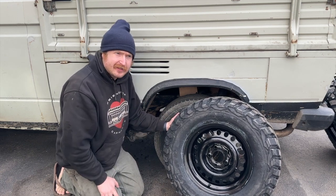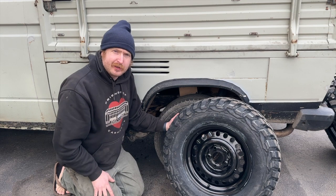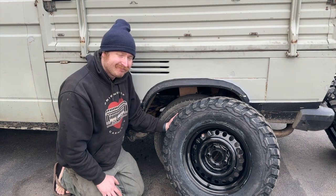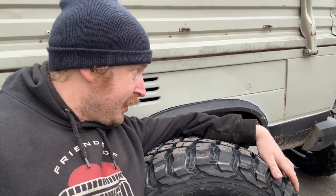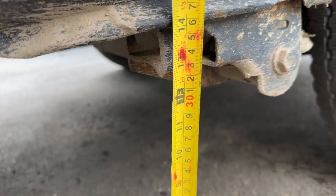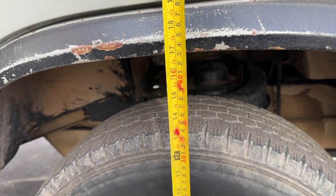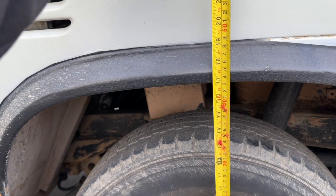We've got these big, massively heavy tires mounted to Go Westy steel rims — Go Westy manufactures these to be the correct offset for a Vanagon. I like steel rims because they tend to be the most durable and we're going to beat the crap out of this thing. I took some measurements — these tires are about three and a half inches bigger than the stock ones, which is significant. We're taking measurements around the chassis so we can see how much the overall vehicle goes up once we add the lift springs and the giant tires — right around 12.5 inches to the bottom of the jack point on the driver's side rear, and the front fender lip to center cap is just about 17 inches.